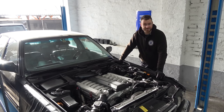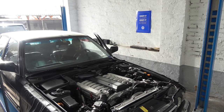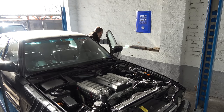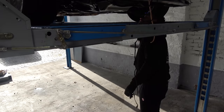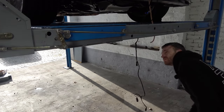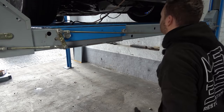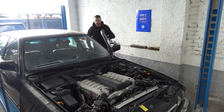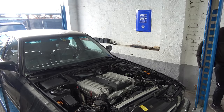And now the question you always ask yourself whenever you've done some work on the engine — does it still work? Only one way to find out. The oil light is not going off. The oil pressure light came on — it should go off within a couple of seconds. The oil level sensor wires are bad but I don't think that should affect it. I just want to make sure we do indeed have oil pressure before we run it for longer, because that would be bad. The engine sounds good but the red oil light is on, so let me do some checking — we didn't do anything to mess up the oil pressure.